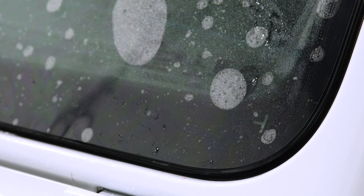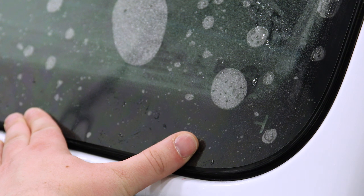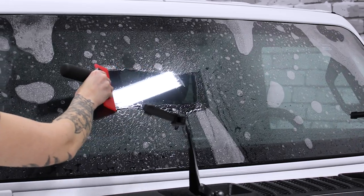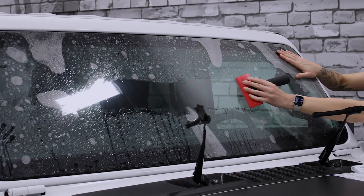This isn't critical at this stage, but knowing what the gap looks like right now and how to slide the film into position will help you align it later when we expose the adhesive to the windshield. It's important to note that if you're installing on an aftermarket windshield your positioning is going to look slightly different. Once you're happy with the placement of your ExoShield, tack the center of the film and you're ready to move on to step 3: releasing the liner.